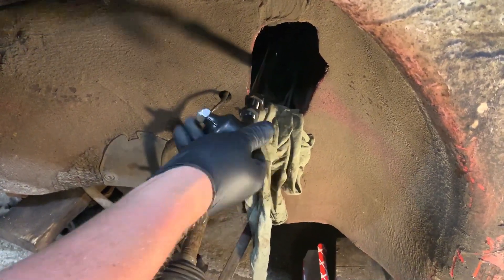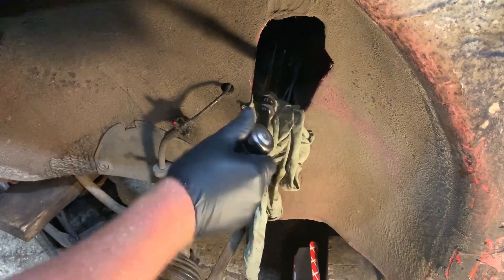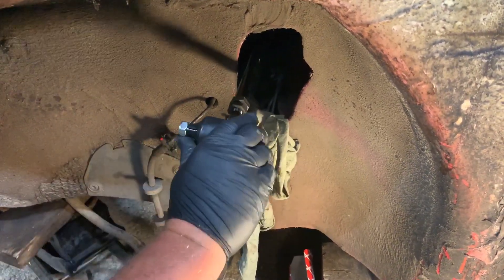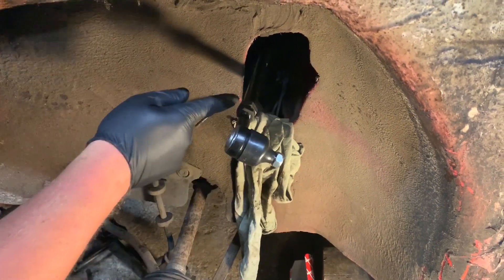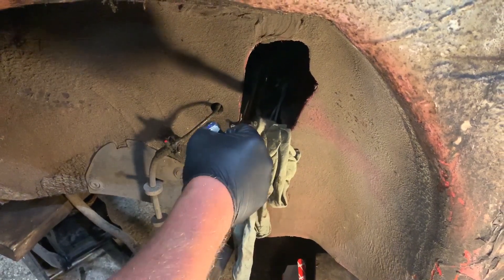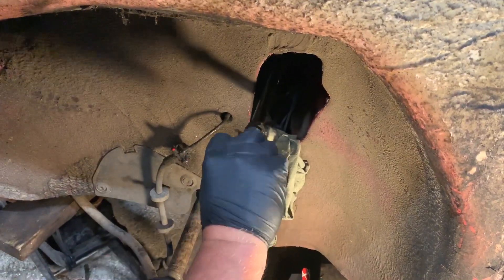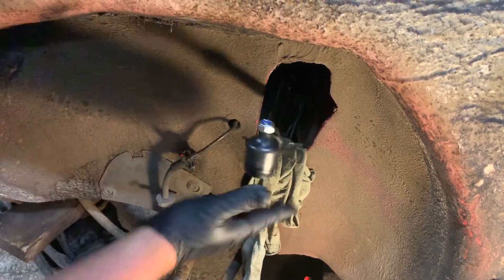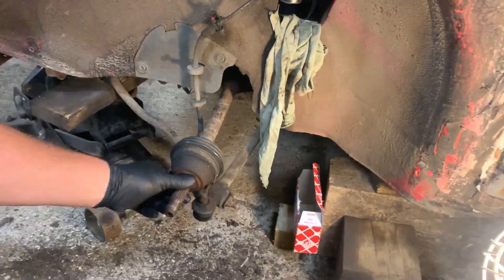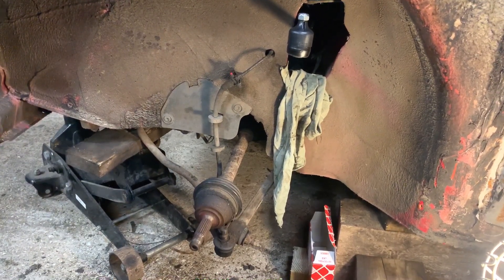It's going to be pretty close how I measured it. I want to get the car out and use it so I'm not going to mess around trying to change the other side track rod end at the moment, but I will do that at some point. I'm not even going to tighten the nuts quite yet - I just wanted this in before I put the suspension leg back on. It's just got to go around half a turn more because it bolts into the suspension leg.